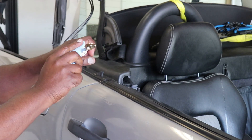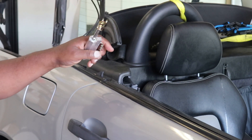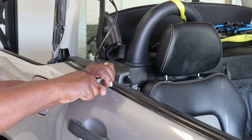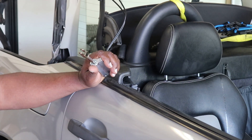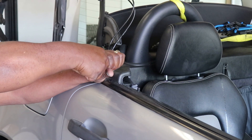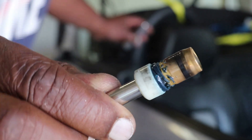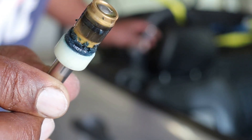Make sure you thoroughly clean all metal shavings away before opening it up. Also open the bleeder valve on the pump in the trunk, because whether you push or pull the ram, fluid has to move through the lines, so you need that vent open. Then gently work the top part out by hand. The seal is completely disintegrated — I'll replace it with the o-ring from the kit, and it should be fine for many years.